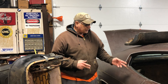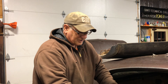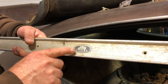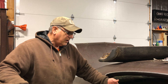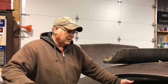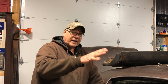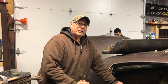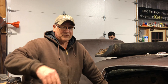All this rusty stuff will get cleaned up. I got the front seat out first, then went to the back seat — and that's the bottom of the back seat. These are the sill plates, the old Body by Fisher. I'm hoping to be able to clean these up and maybe detail them to look new. I'll take the carpet out, all the sound deadening stuff will come out. Then I'll put lubricant where the bolts come through the floor, push it back front, get it on the lift, raise it up, and take all those body bolts loose. Then I'll let it down and put jacks under the body — outside the frame — so I can lift the body right up off the frame and it'll stay in one piece for the time being.